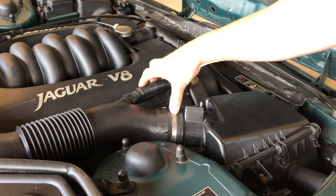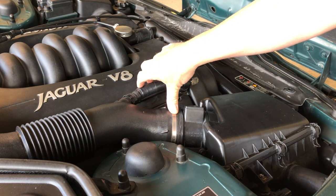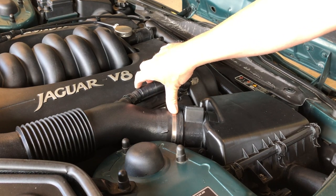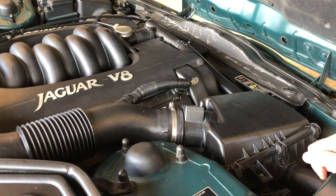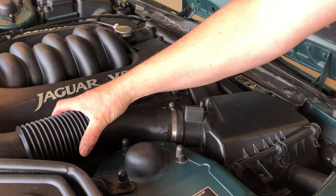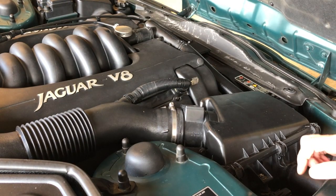And the effect is that the engine would run lean, or not enough fuel, which can be fabulous for your fuel economy, but will also cause all sorts of things like burning hot. Long term it could damage your engine, and will damage your performance, et cetera. So this pipe's important. There are several others that have the same effect, and having this snorkel in good condition is one of them. This should all be sealed as a system, no leaks.